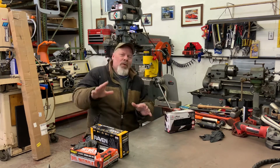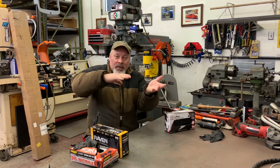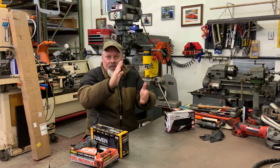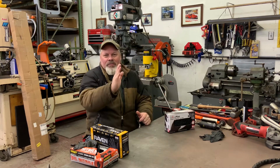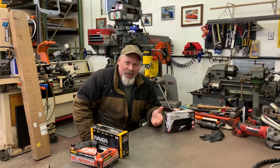I had to think about it for a minute, but yes, I'm going to let the car down on jack stands to get the rear end up to ride height. I'm just going to let the front end go down on the ground. I don't care if the car was sitting like this. All that matters is the differences between the two parts, not if the car's level or not.